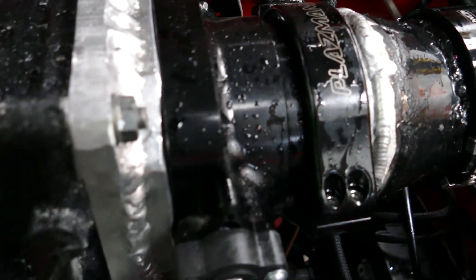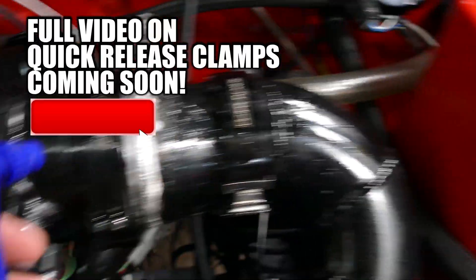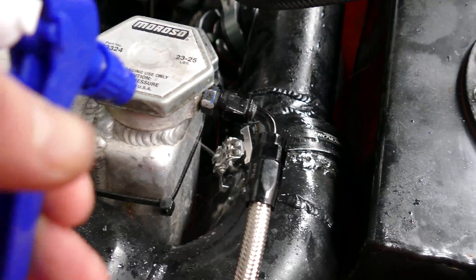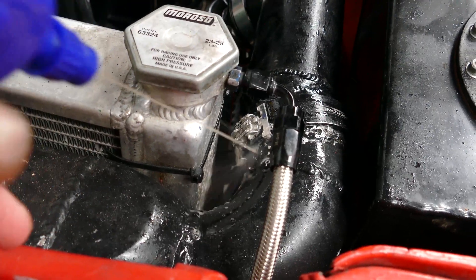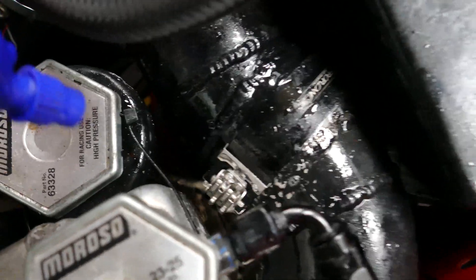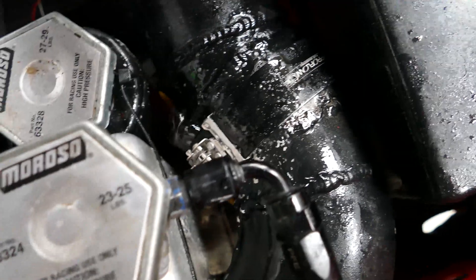You can see — one's working and one isn't. It's already kicked the air compressor on because the leak out of this one is monumental. You can see that one's not leaking at all, but the other one is massive. It's even worse down here — the air rushing out is actually blowing the water away before it can even foam up. You can see it. And that's just my boost — my hard-earned boost just being blown out of the system.